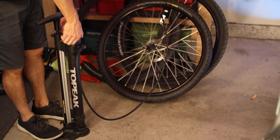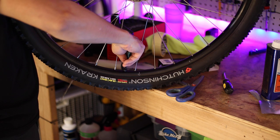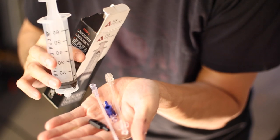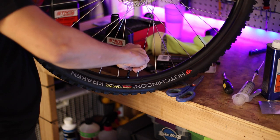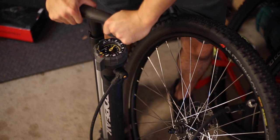In addition to these three inflation options, you also have a choice as to when to add the liquid tire sealant. I prefer to inflate and set the tire bead dry with no sealant at all, then deflate the tire with the tire bead firmly in place, remove the valve core, and add the sealant through the valve. A tool like this one from KOM Sports on Amazon is purpose-built for this, linking a syringe to a skinny but rigid tube that feeds directly into the valve. Once you insert the desired amount of sealant — about three ounces for these tires — you can reinstall the valve core and pump it up as normal. This method takes a little bit longer, but in my opinion it's far less risky and certainly more methodical, which for better or worse is just my style.